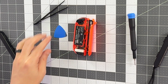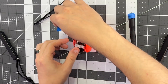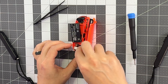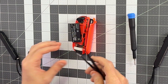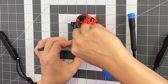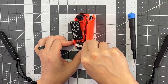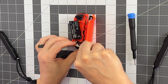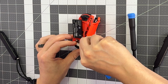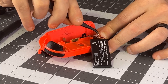The next thing we're going to deal with is this battery. The battery is just very lightly glued down, so you can take your spudger, insert at the side, and pull up—it will just pop out. And the other thing we need to deal with is the connector. You have to be very careful here. You want to pull upwards at the connection point—not out, but straight up. That is how it connects. Make sure you don't pull on the other two wires. So grab on as low as you can, try to get into the connector, and give it a pull straight up.